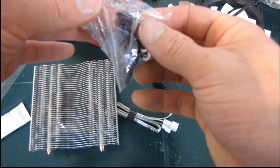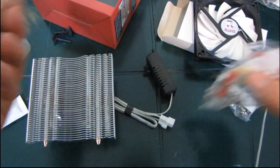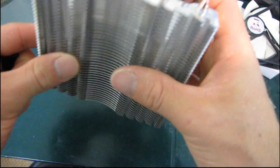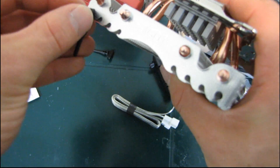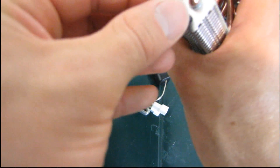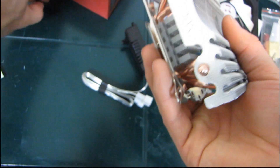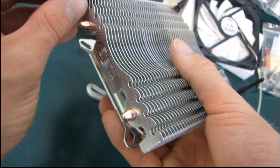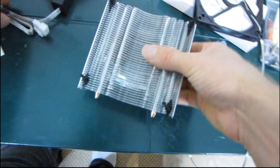Unlike all of the others from this series, this particular heatsink is not push-pull compatible, although I can't imagine any reason why you would be trying to mount a push-pull cooling system in an HTPC. You get more static pressure, but the whole point of this thing is low profile. You don't want to throw two fans on it — you'd be far better off putting more metal on it at that point. The whole purpose is to get it as small as possible.